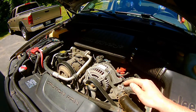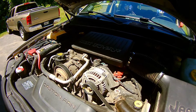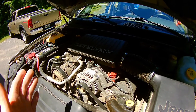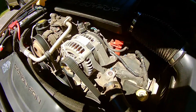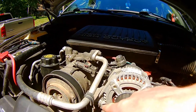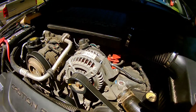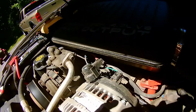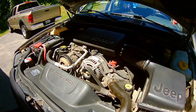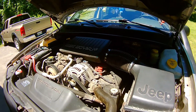...you're going to tell them you need it for an '05 Dodge Durango Limited with the 4.7 liter — I believe that is VIN N as in November. That is a 160-amp alternator, same price and everything. As you can see, it bolts right up — you've got a bolt there, a bolt there, and a bolt there, and they all bolt right up. Same size width for the belt, and even the connectors go directly on. Same price, and you get 24 amps more of charging power — great for your winch, compressor, fridge, or any other accessories and lights you're going to be running.